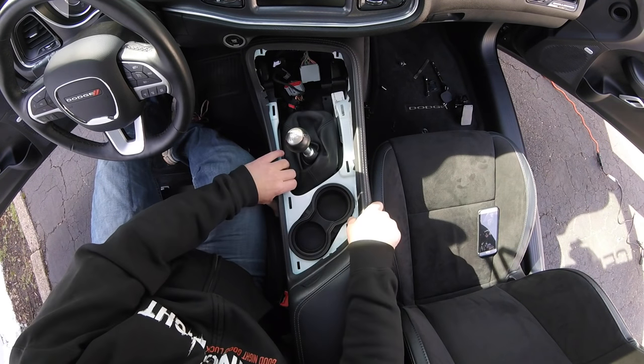Now how do we get the metal plate off? You want to jam a pry tool in there because it looks like there's a seal or gasket around there. The shifter is going to drop in - take this and put it off to the side. Get down into here and take a look at how loose this is - right here, and here - this whole thing is just a big wobble stick.